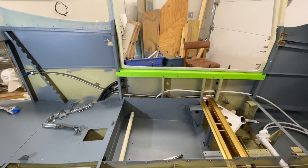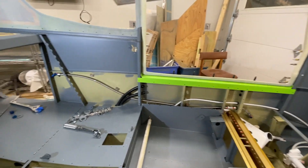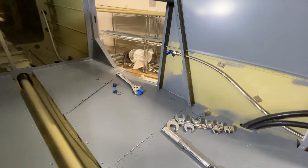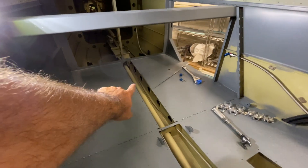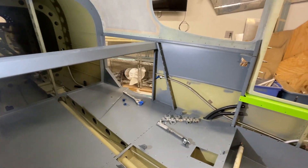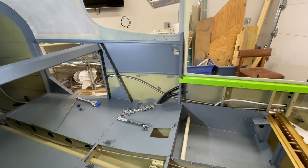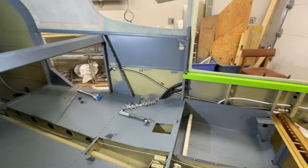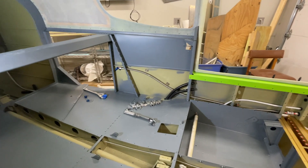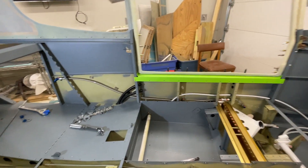And what the ferry line gets us is if we ever want to do a really big crossing — hint hint — we are able to plumb something into the back. Like, this is the baggage compartment over here, here are the rear seats. We can plumb something into the back that will just pump into the tank. The benefit of this versus having an additional tank is, I don't have to vent this — I just need a pump that shoves this into the actual fuel tank.